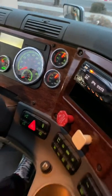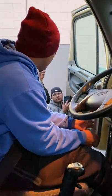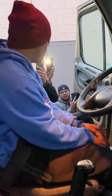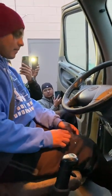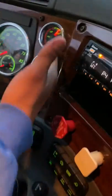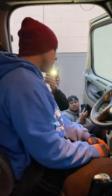Okay, so when the minute passes, guys, always let the minute pass like around 5 more seconds, like 1 minute and 5 seconds, okay, just to make sure. Okay, so it's 1 minute 5 seconds. I stop my time. As you can see, I did not lose more than 4 PSI in 1 minute. It was a good test.